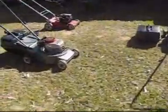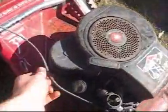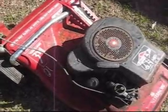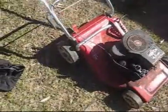Yeah, and often I mow out here, just testing my mower, seeing if there's a few big strips mown. So I'll change the oil and put in some fresh oil, and hopefully that'll stop it smoking. And put a new one of these cables in, because that's shot. I could probably straighten it out, maybe using a bit of heat, but I don't know, I'll just put a new one in, and yeah.